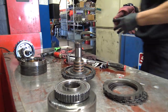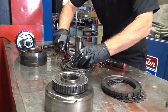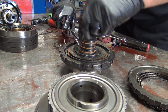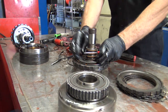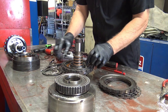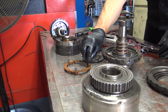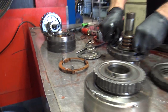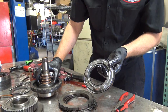It's always best to have the right tool. There's a snap ring and a big washer that holds everything together. We've got some springs — lightweight springs, real little ones — and then there's an apply piston in here. It should come out now.